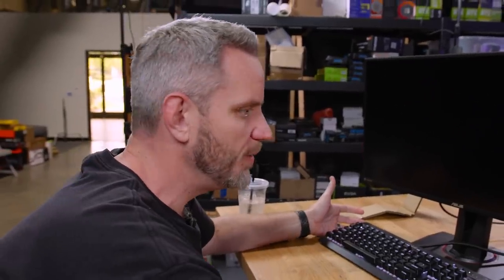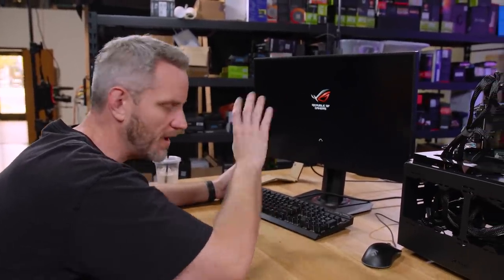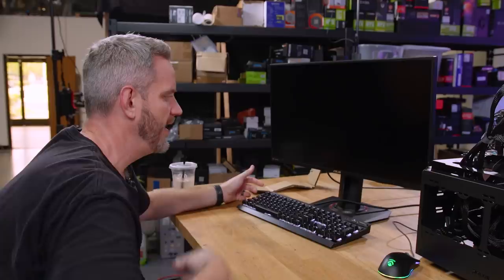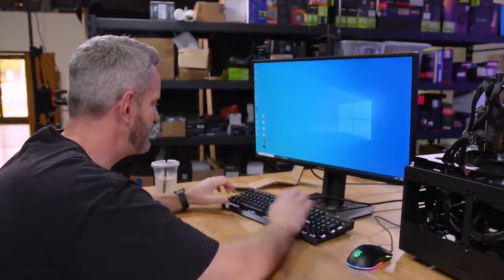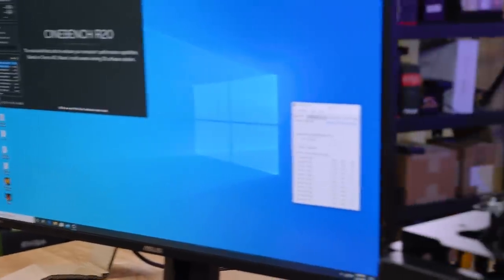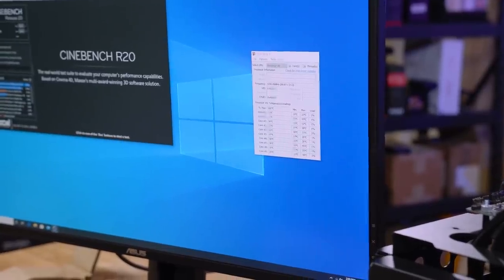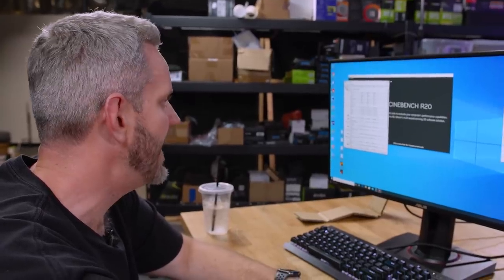Okay, so we're running into some pretty sporadic stability problems. So I'll show you a run right now. It just crashed and we're restarting. We ran the test maybe 4 or 5 minutes. Yeah, maybe 8 times or so. And I have a theory right now. So if we look at temperatures here, it's at 5.4 gigahertz. And if we take a look at temperatures on Core Temp, cores are sitting in the teens, voltage is at 1.55 right now. No, 1.52, I think. I don't remember. It's 1.52.